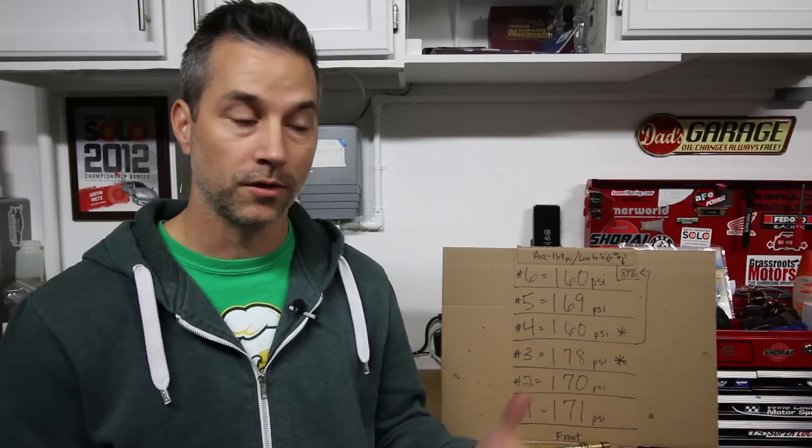We're going to wrap it up — compression test process for an E36 BMW. This process applies to pretty much any other car as long as you have easy access to the spark plugs and know how to shut off the fuel system so you're not squirting fuel into the cylinders during the test. I'll put links in the description for the compression tester tool I used — you can also find them at your local auto parts store, and sometimes they even rent them out. Hope you enjoyed the video and learned something. Leave any thoughts or comments below. Stick around for more E36 BMW videos this off-season. Stay fast out there — talk to you next time.